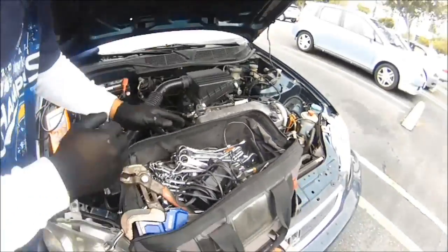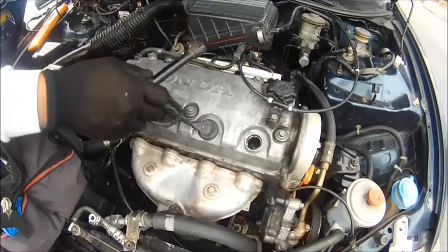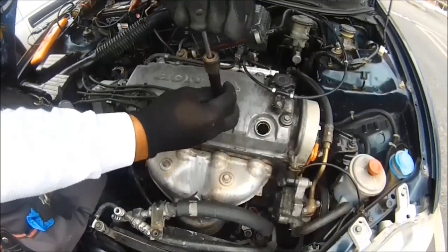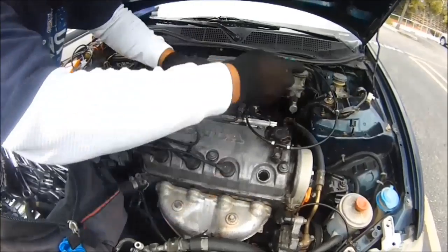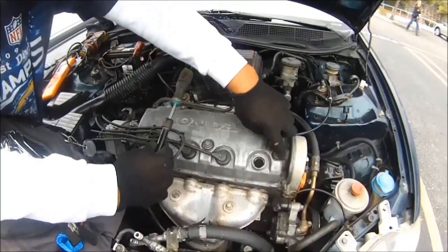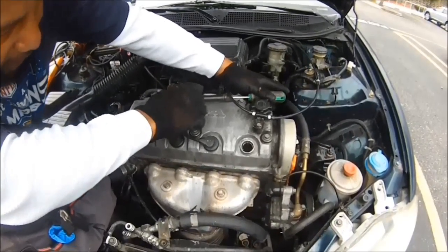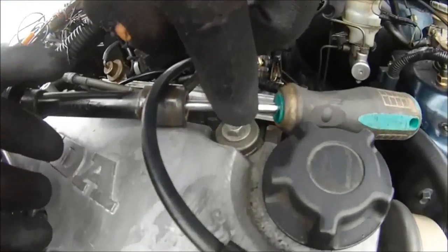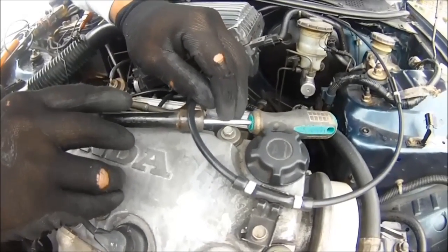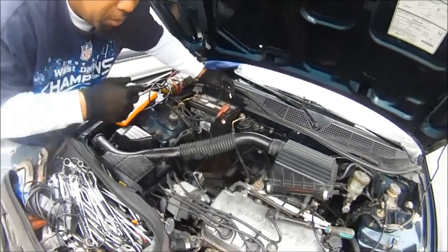So now, what you do is come over here, pull the spark plug wire out like that. Get a screwdriver, stick it down in the terminal until you're tight. You're going to stick it down like that and put it on a ground — these are attached to the body with the engine chassis. And you're going to leave that with a gap — about an eighth of an inch between the top of the bolt and the screwdriver. Then look over here, you're going to touch this terminal and look for spark.